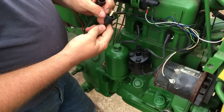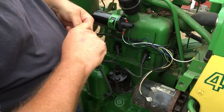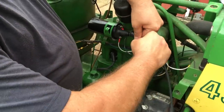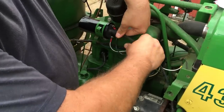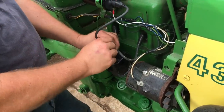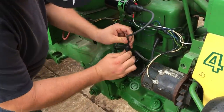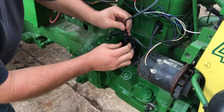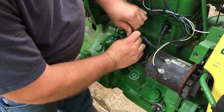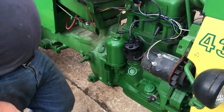The big boot goes to the coil — push it in until it snaps; you can feel it click. Then slide the boot toward the end and do the same thing down to the distributor cap. Sometimes you have to work with it to get everything to pop into place — a tight fit is what you want. We also installed new spark plugs while we were at it, since it makes sense to go that route while everything is accessible.